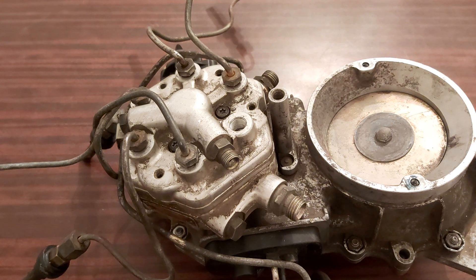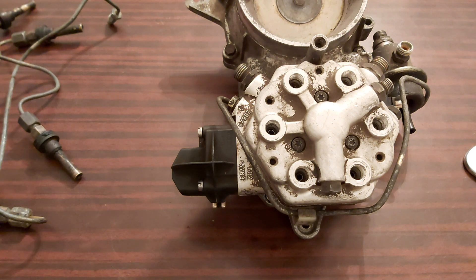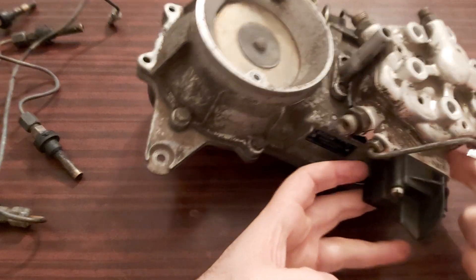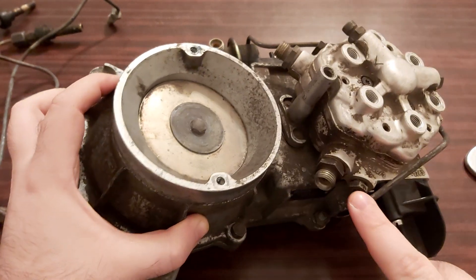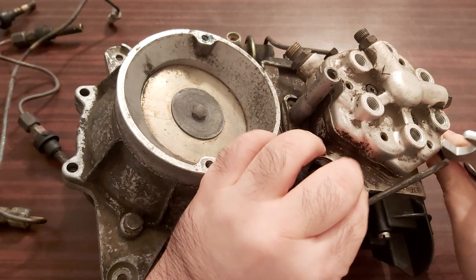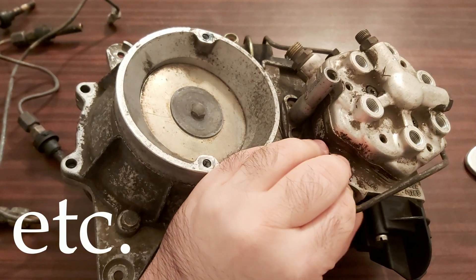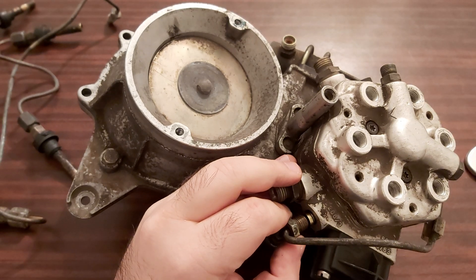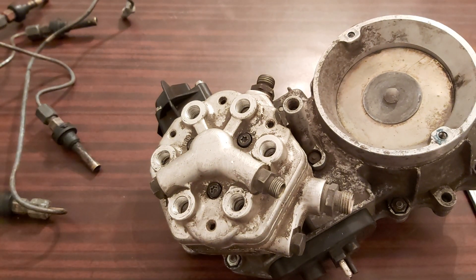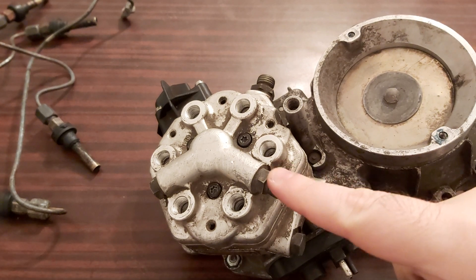This line is removed. Once I finish removing all of them I'll be right back. The injector lines are removed. Now we need the differential pressure line removed as well — it is wrench 12. The differential pressure line is now removed. You will also have to remove the line coming from the cold start valve.